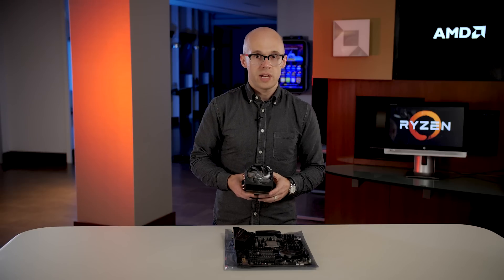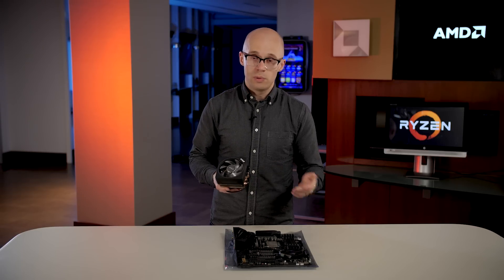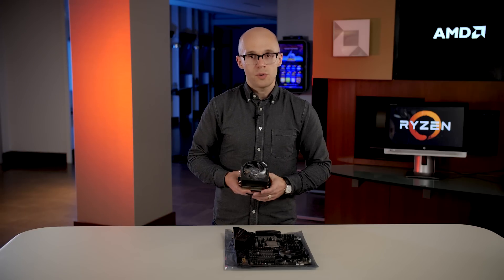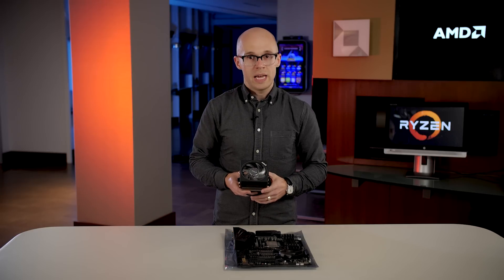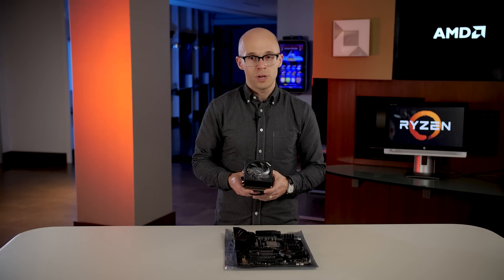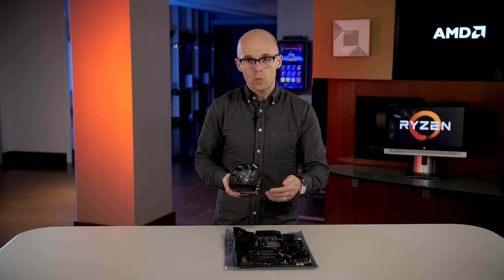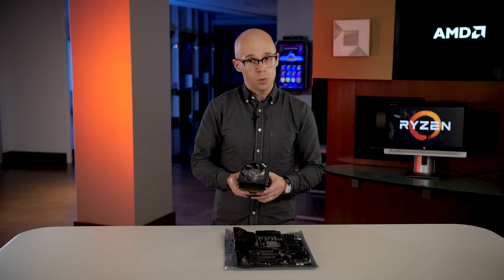It's a good idea generally to have more cooling capacity than you need. So, if for example you have a 95 watt CPU, a middle-of-the-road 140 watt cooler would be more than enough and help you get the cool and quiet computer that you're looking for. Those wattage specifications — that 140 watts or 95 watts — are almost always listed on the specifications for the cooler.